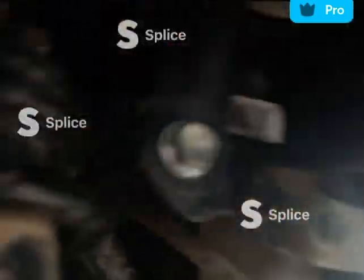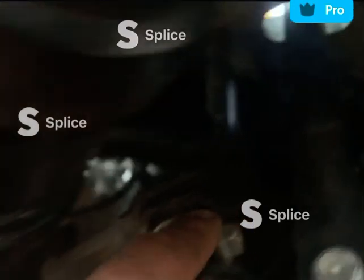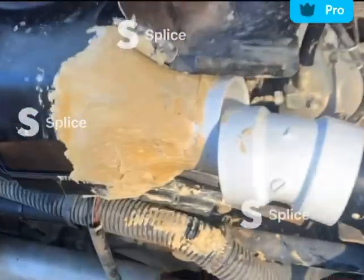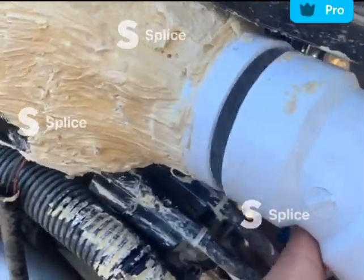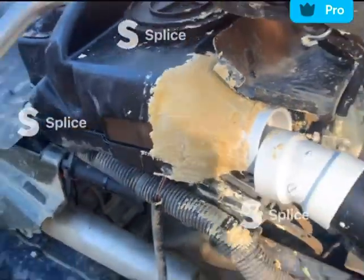And then for the intake, straight down, elbow, about a 3-inch piece, elbow. And then I ran a straight pipe at an angle. You probably can't see it. I'll post a photo at the end. But straight pipe that runs straight up. Underneath here, it literally went straight up into a 45, then a 22.5. Then I have a male or a female adapter.